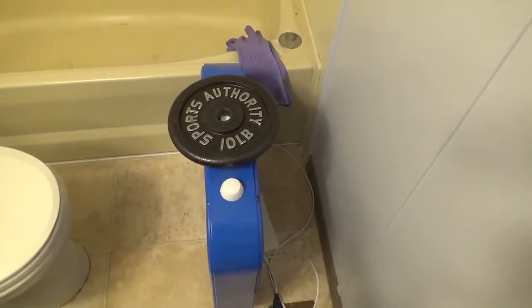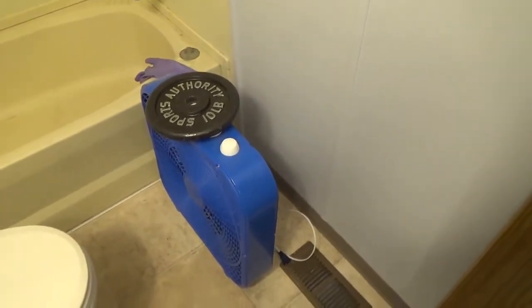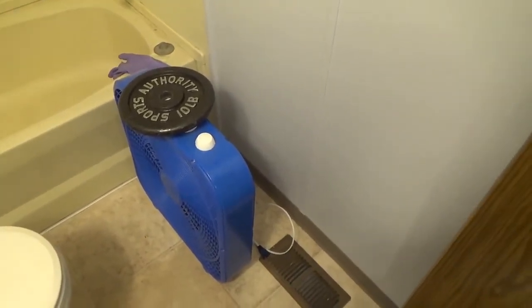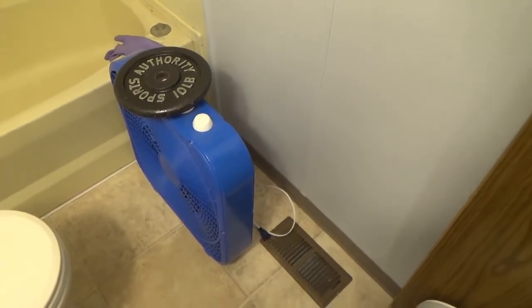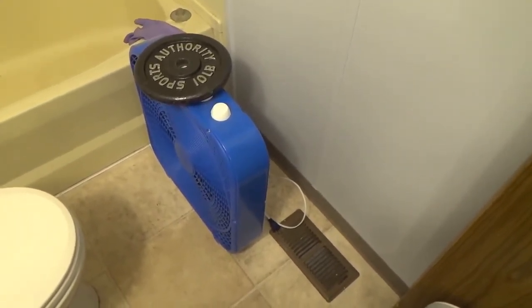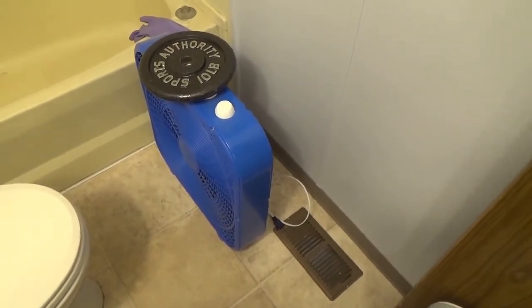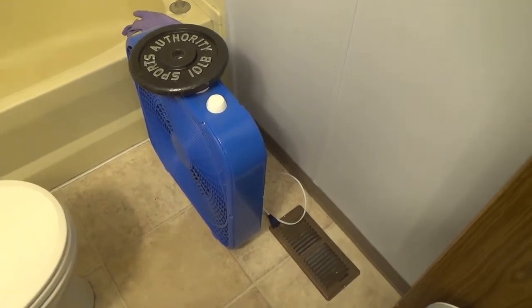So what did we learn? Well, we learned that the 3D printed parts have a strong anisotropy, and we knew that. And as a result, sometimes the strain state they're placed in results in failure. That would not happen if you had, say, an injection molded part such as the original part.